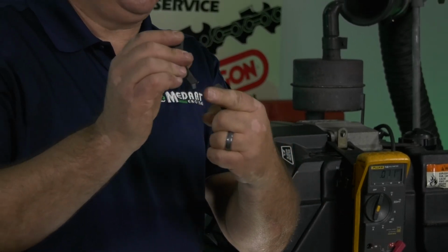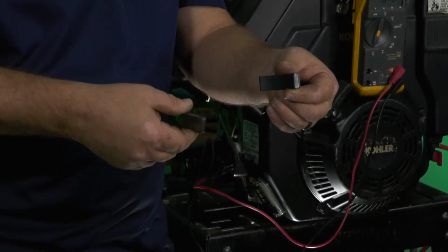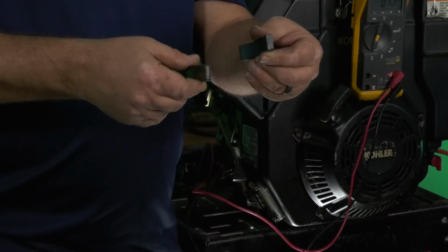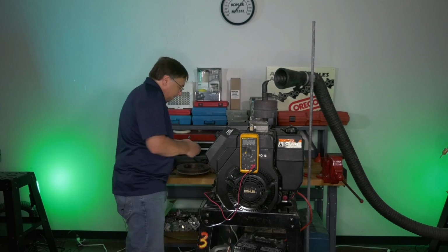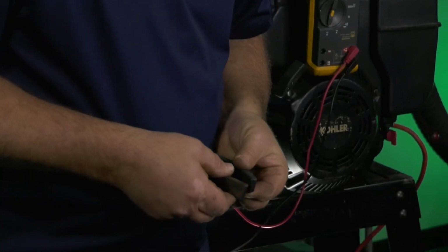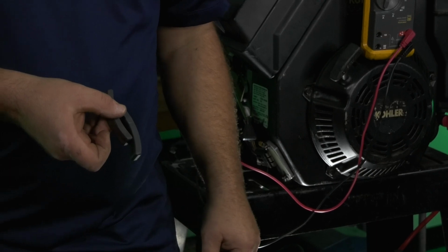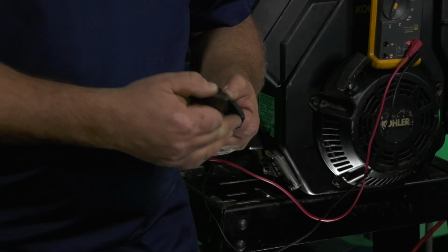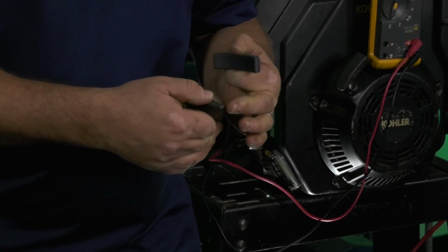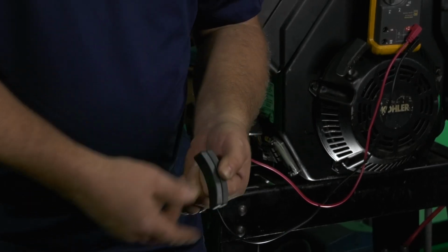They'll have a north pole, south in the center, north pole in the end, and vice versa in the opposite magnet. So now it doesn't matter where you put them in series, right side up, upside down, if you're trying to glue them back in. But if you get them out of sequence and don't have them proper, you'll get magnets that I can't push together. Okay, this is where they snap to. Because the magnetic lines, the north and south poles, again, outside to center, south, south, north, north, north, south, they'll grab like that. I can't push them together. I lay them backwards, they snap.